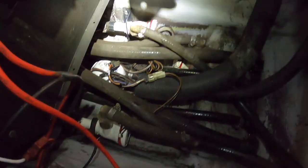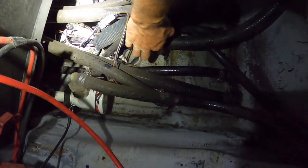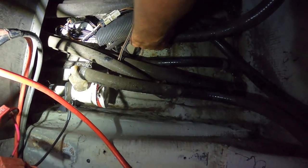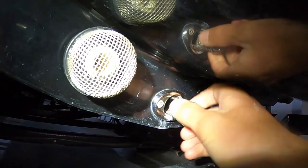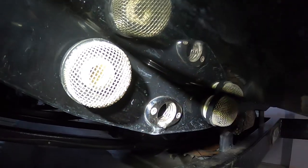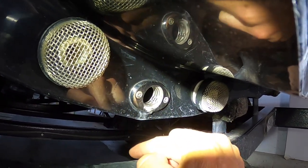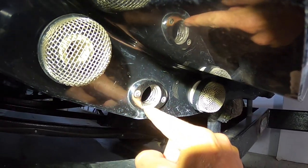Coming around the back of the boat here, I'll show you inside the bilge — I had to work on some pumps while I had the boat home. This is the backside of the drain plug right here. We'll go down to the bottom of the boat — here is your actual plug. The first thing we're going to do is get the debris out of the way and unscrew that. Then we're going to take these two screws out and the new piece is going to go in here. What I've read from people doing this prior is this is the hardest piece to get off because of the adhesive.